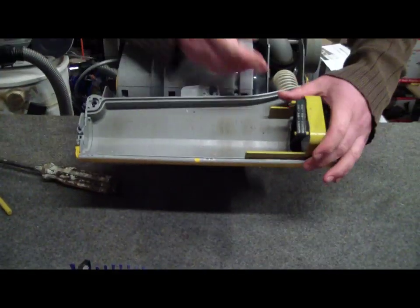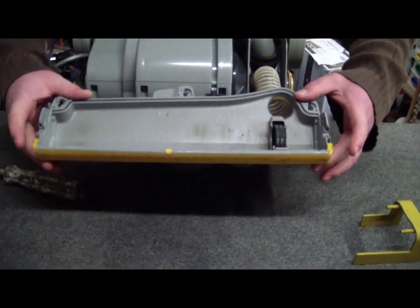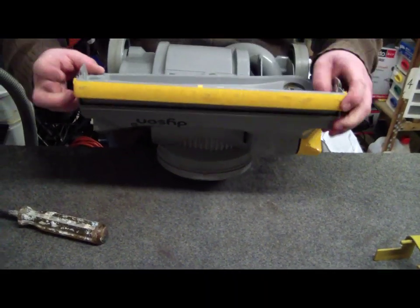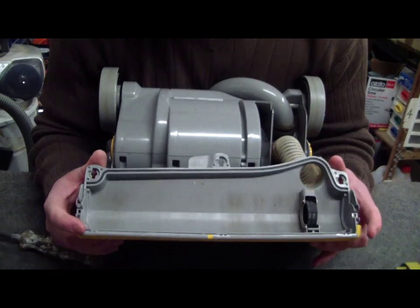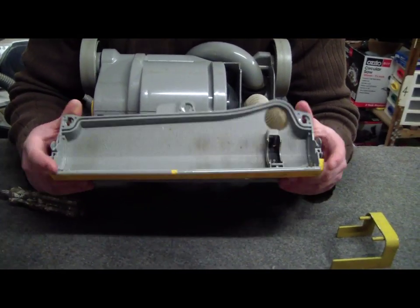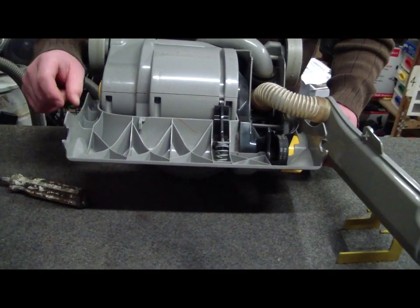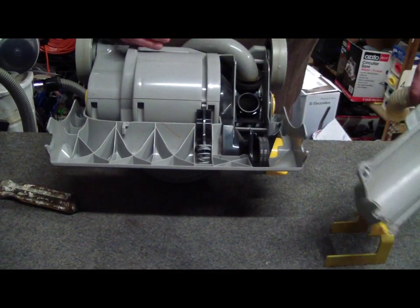Move that aside. Then you lift the belt off the tool and you pop your fingers — see how I'm putting my fingers in between these two parts. And what I'm going to do is roll this up both sides until it comes out. Now over time these teeth here get pretty brittle, so you want to be as gentle as you can. Just lift that aside.